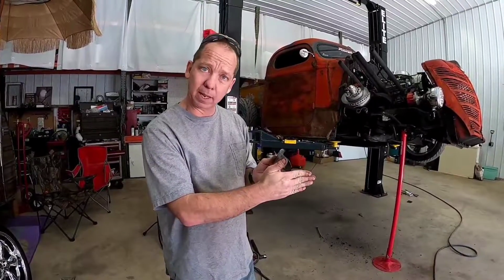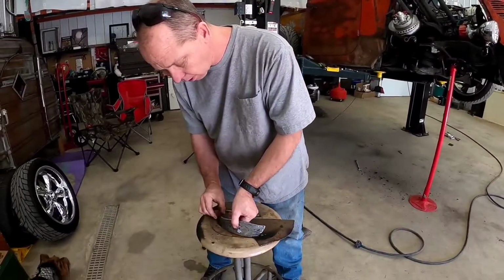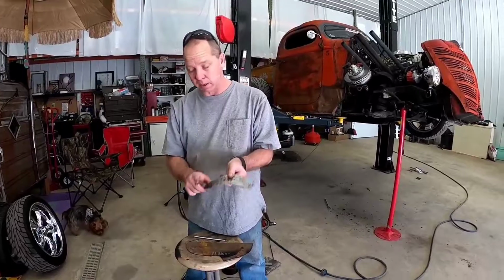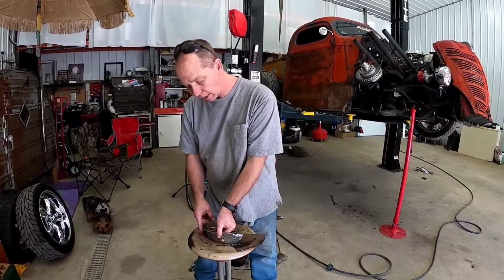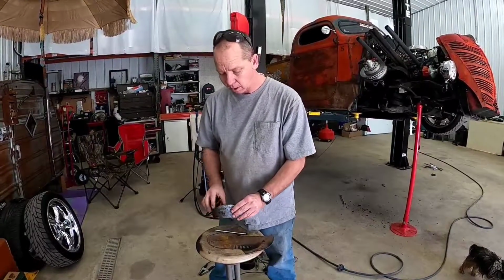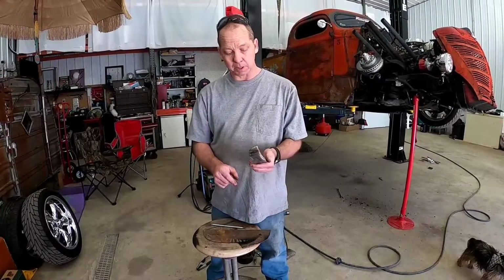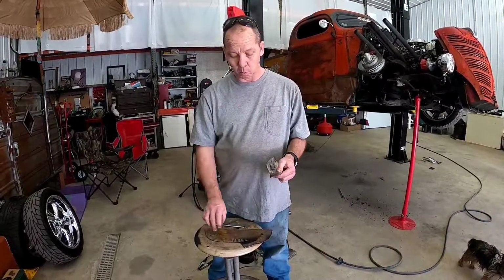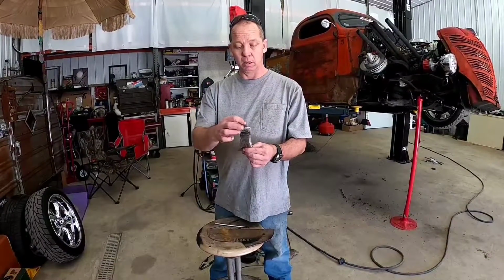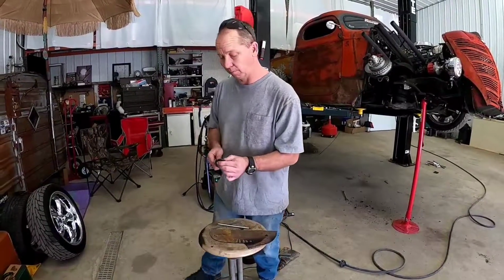And then up there toward the front where the sway bar was, I want to bend that in. So I've made a relief cut with a plasma cutter so that I can put a bend in this. And when I get to here, I'm gonna go ahead and bend this and then draw that line around there. I'll go ahead and tack this on here and then start rolling that around with the heat on both ends. And plasma cut this piece out of my scrap metal when I get it done, and that will make that lip. So I'm going to start on that, and we'll check back with you here in a few.